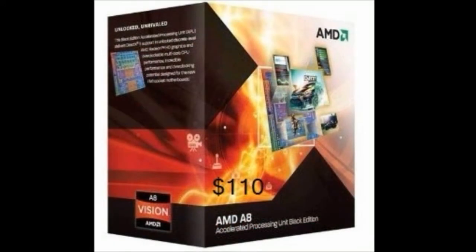It's only a hundred dollars — terrific value, highly suggested. And if you want to spend the extra ten dollars, you can go with an AMD A8-3870K. This processor is very similar to the A8-3850 except it is unlocked. Unlocked processors allow you to overclock — overclocking allows you to exceed the processor's performance, like upgrading the gigahertz of the processor, as long as you know your temperatures and know how to not damage your processor.